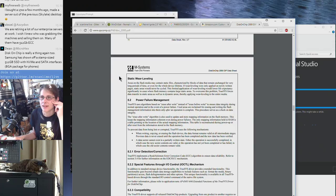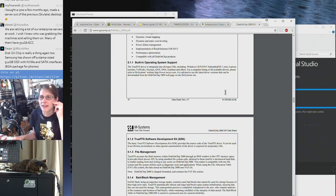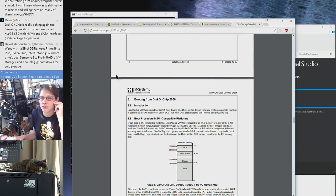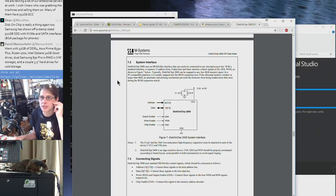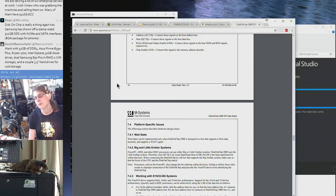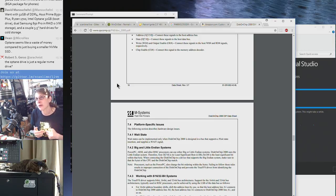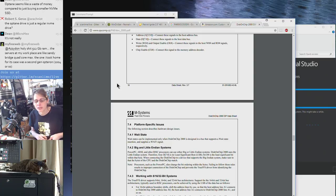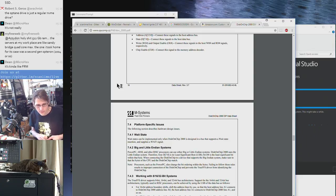Yeah. Oh, wear leveling. I had kind of a weird opportunity to do a bunch of my own Flash translation stuff when I worked at Sifteo. Because we had some pretty weird requirements for the operating system, and I needed to store both big static chunks of data that had very simple mappings, where I could grab a whole page and drop it in one page in RAM and not have to slice and dice the pages and reassemble them. And that was what we wanted for just streaming read-only content. But for stuff that changed a lot, we wanted wear leveling on that, of course, and journaling. And then for updating the games, we wanted kind of a coarse degree of wear leveling that would happen outside those blocks. So it was a pretty weird system.